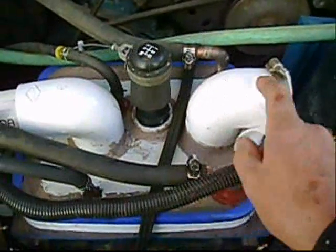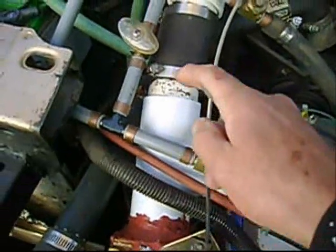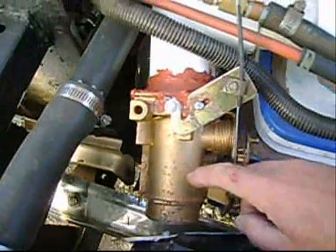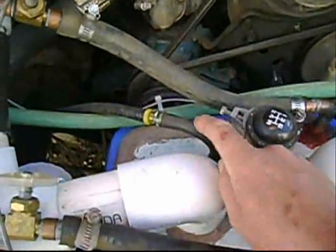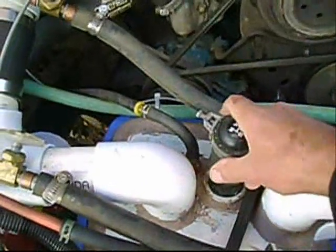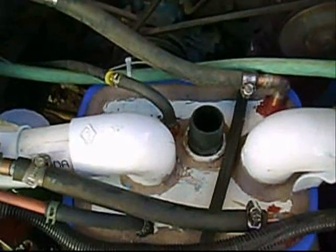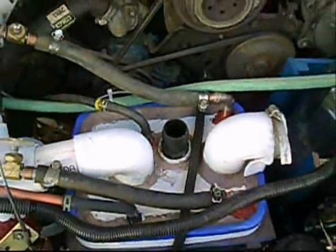This is the air intake into my vaporizer here, and the vapor comes up here, over here, up into the engine. Here's a butterfly valve for my secondary air that I can control with this cable from the inside. Here's my fuel line coming in, and this here I just made a little inspection hole so I could take a look to see how much fuel I have. The level of the fuel makes a difference in how it runs, so here I can experiment with different levels and see which runs best.